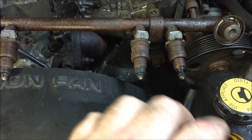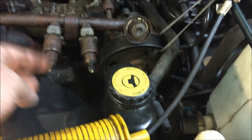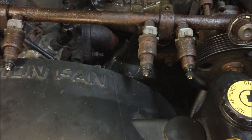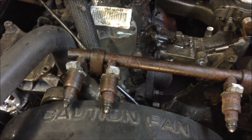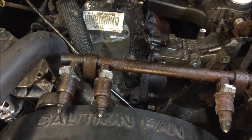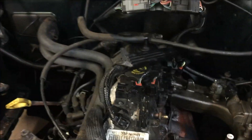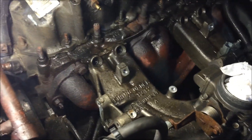I've got to put new O-rings on them obviously. I already pried them out of the intake, so I'm going to put new ones on, clean them all up nice. No reason to change the injectors themselves if they're not broken — they can last forever, and they're pretty easy to get to anyway. Also going to change the valve cover gasket and PCV valve up there. Getting close to having this off, it's getting late in the afternoon.